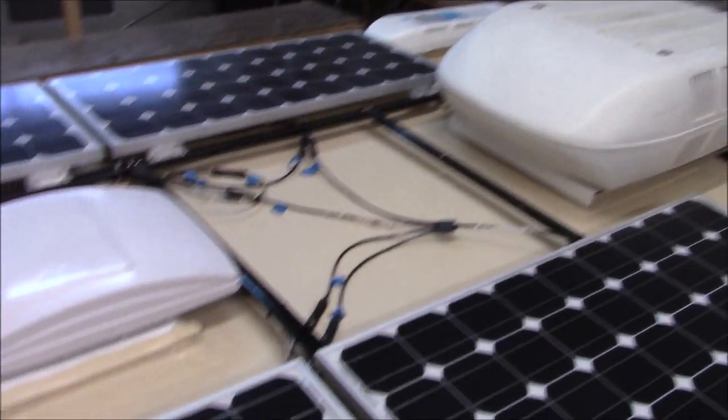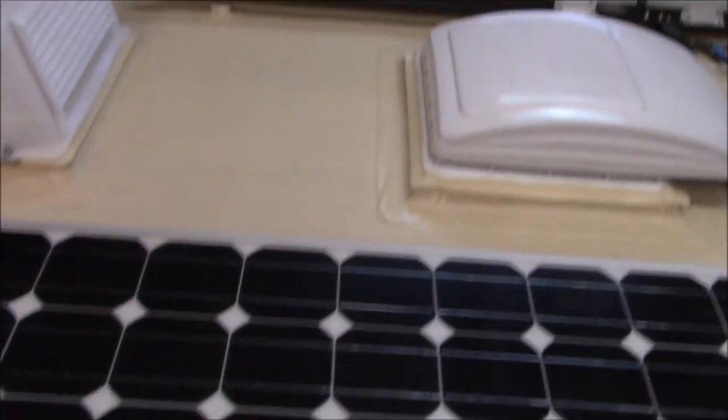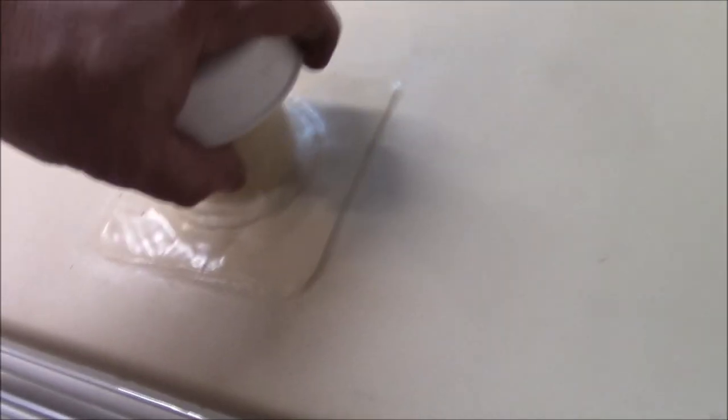So this is a 60 mil TPO. That's what it is. It's thermoplastic. That's why it all heat welds together. Even if this bell cap popped off, it's sealed up underneath there. So even if that popped off, it would just go down into the holding tank.